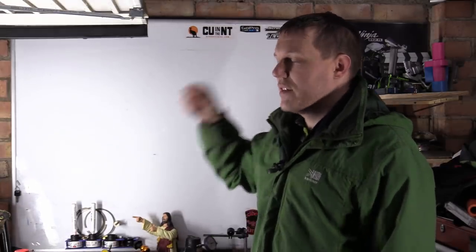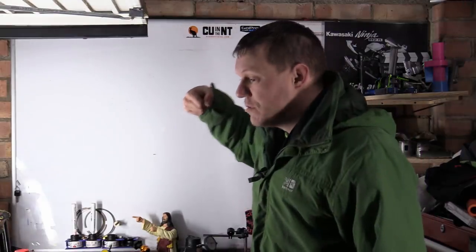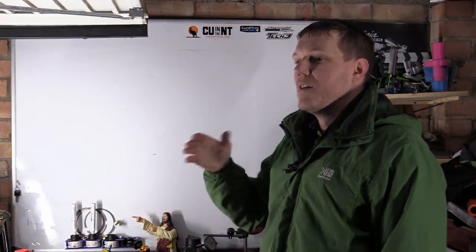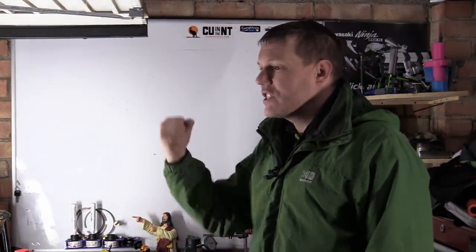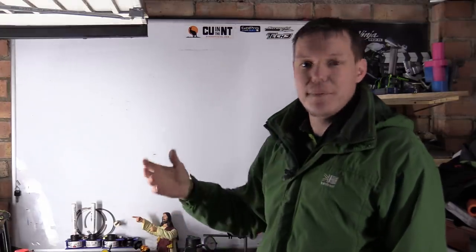This is why it pops, because you're wide open throttle, the injectors are giving it full blow, you are in the power band, you then shut that throttle off, but there's a lag there. The engine is still going fast. When you shut your throttle, your engine doesn't instantly halve its RPM.